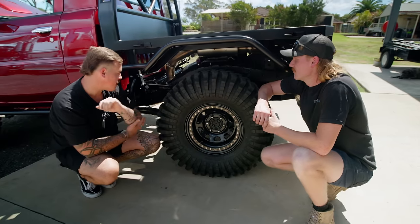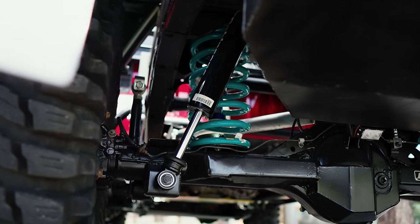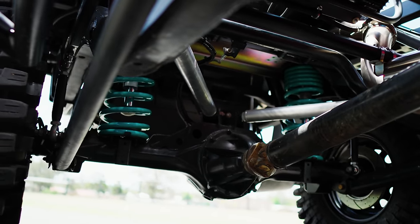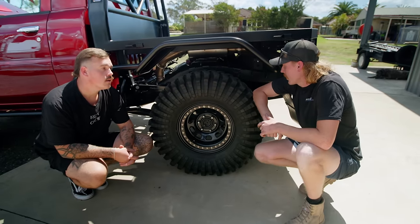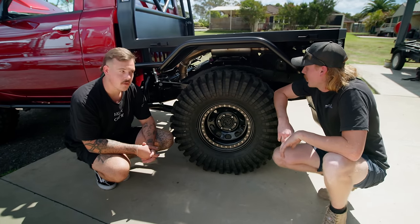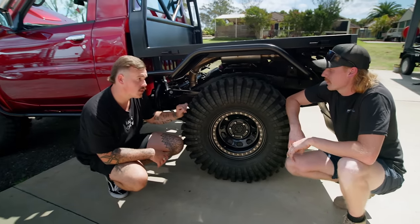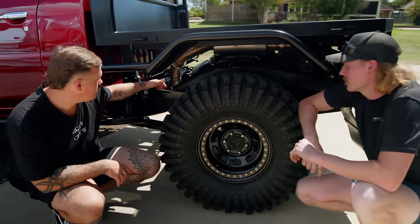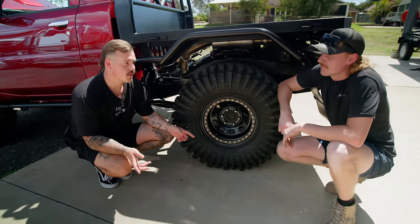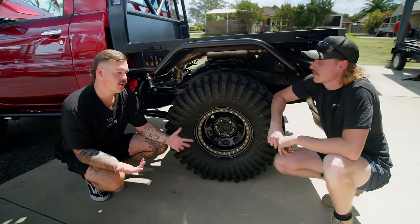Hiding behind the spare tyre is the rear suspension. The rear is a bit more fruity than the front: Dobinson 2.5-inch shocks, Superior hydro bump kit, PSR long arms on the bottom, a Camfab panhard kit on top, and Ali upper arms machined by Hilfab. There's also a massive DFI sway bar in the rear — you don't have to take it out when you go wheeling — which is a big advantage over a standard sway bar.